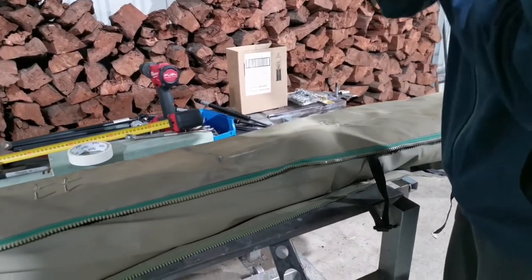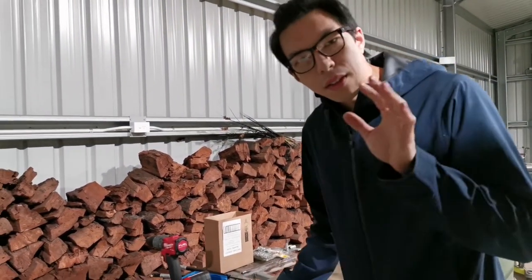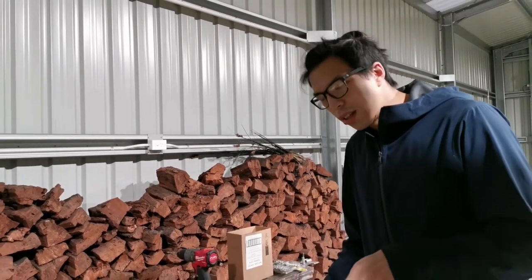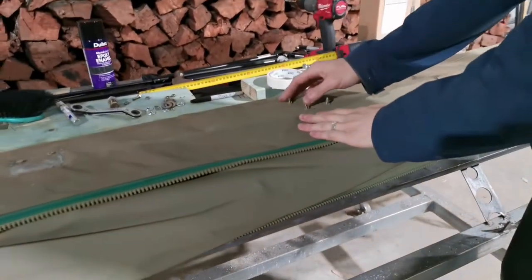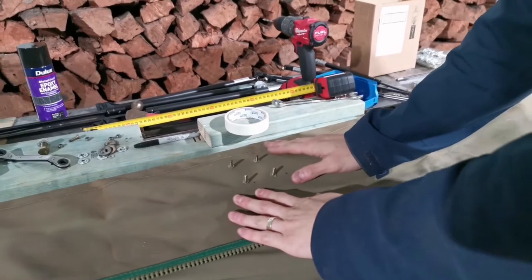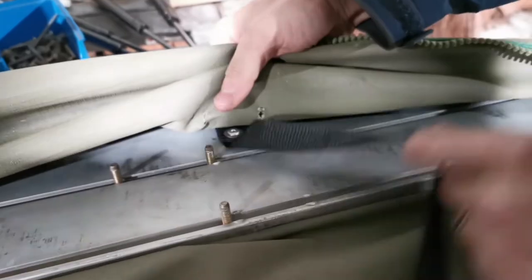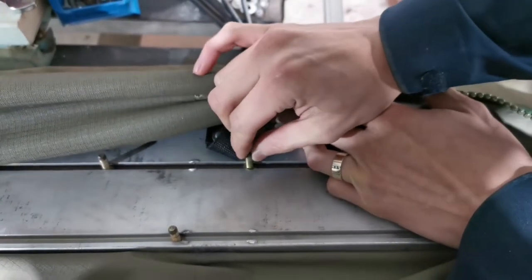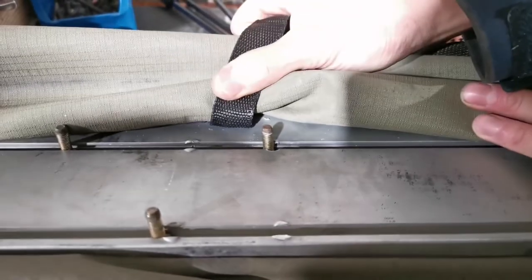Alright, so we've noticed a problem with this awning. I always say simple projects are always not simple, because there are always hiccups, and here's an example. So that's how we've been mounting the Ostrich awning in the past couple of years, from the aluminium channel inside, as you can see, that's a channel. Now, the problem is, the channel isn't really strong enough, and apparently the high tensile M6 has been pulling out. Whether it is from over tightening or not, I think it is very hard to prevent.